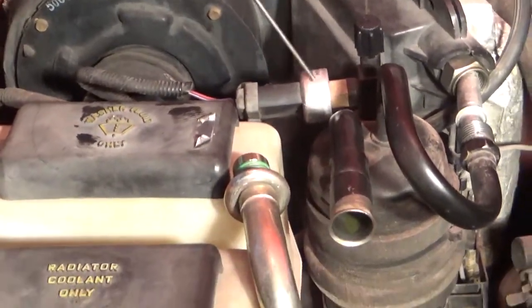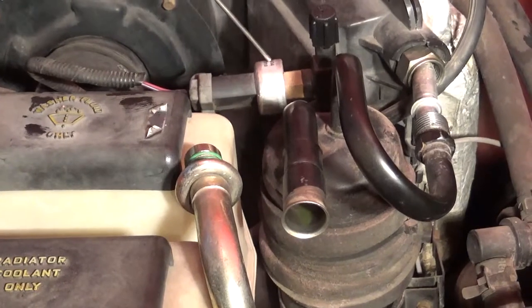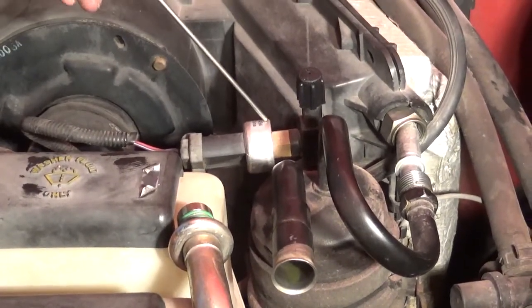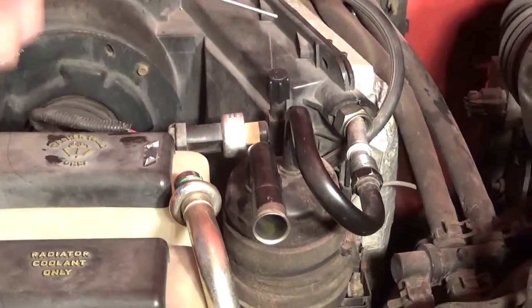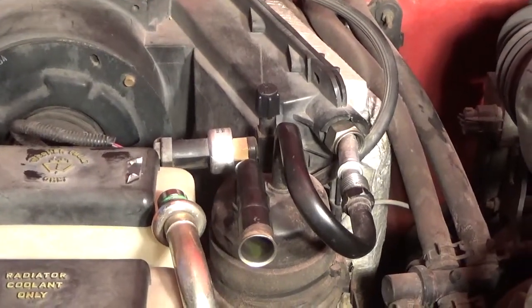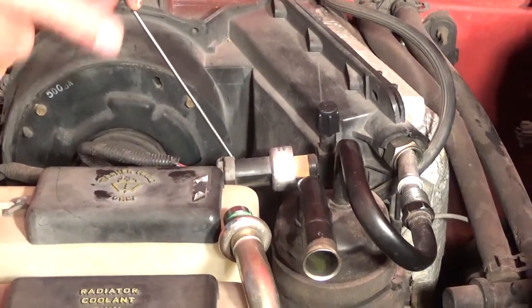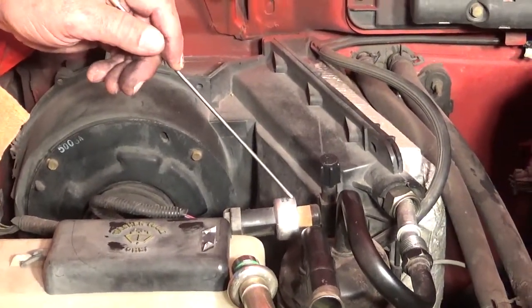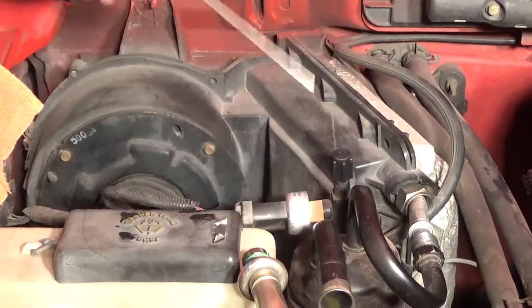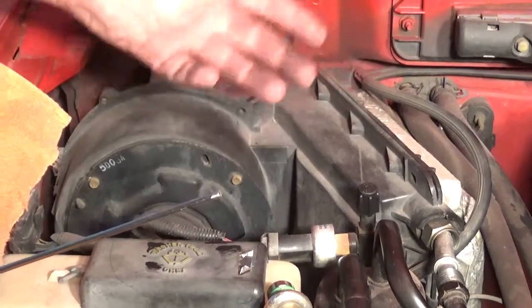All your lines underneath that go through are still intact. The only other thing you have to do now is — you see this? This is a high pressure switch. What happens here is this gauges the pressure as it comes through this system. If that pressure goes too low, it discontinues power and the compressor shuts off to save the life of the compressor — if it's running with no fluid going through, it's a dry run, just like an engine without oil. The system does have a little bit of oil in it. Also, if the pressure gets too high, this will save your compressor.